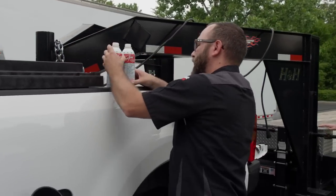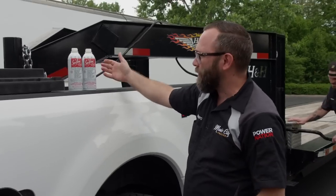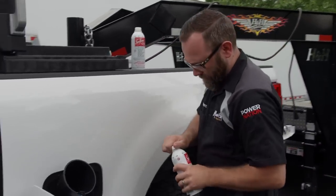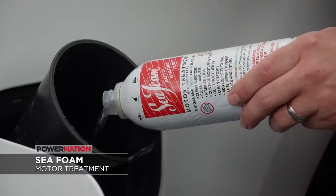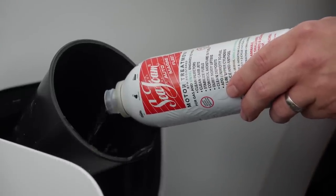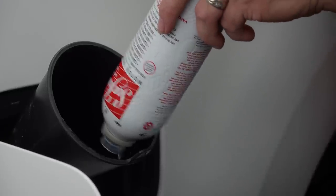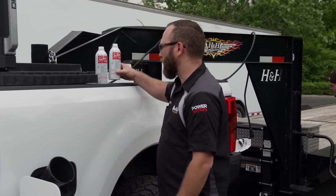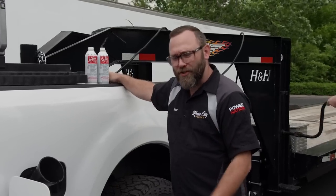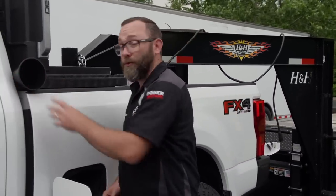There are some things that we like to do here with our fleet, even though this is a brand new vehicle. We like to take care of the fuel systems, and we do that with Seafoam motor treatment. This stuff is good to clean and lubricate your entire fuel system. It works through your fuel injectors to remove harmful residues and deposits from fuel passageways, intake valves, pistons, and chambers. I added about one ounce per gallon — you can add one to two ounces per gallon, even though this is a new truck. Sometimes they sit for a while, so you could add a little bit more, especially for something you're going to leave sitting for a long time to keep the fuel stable in your tank.